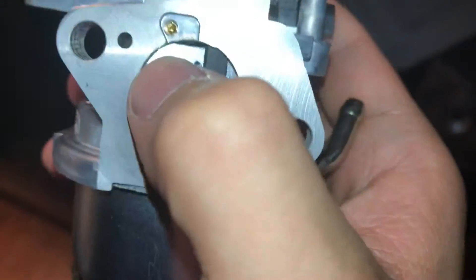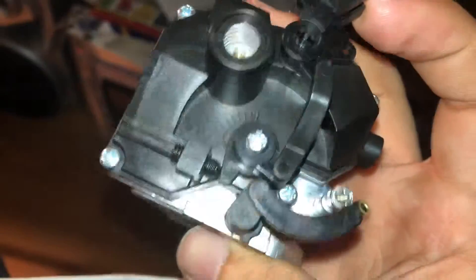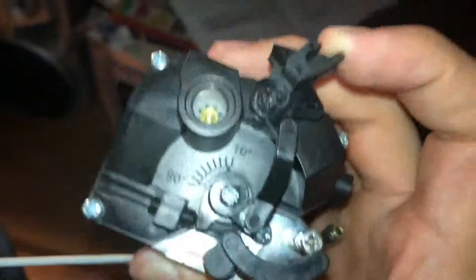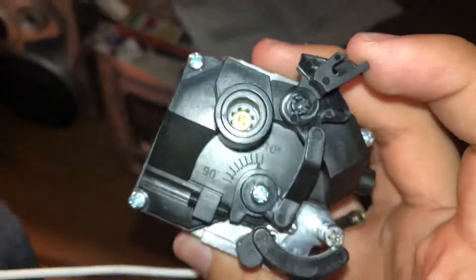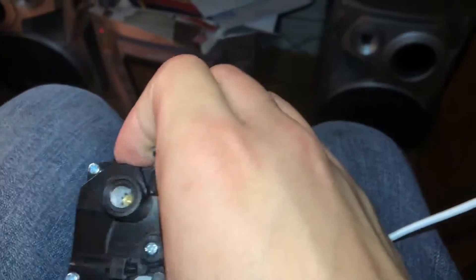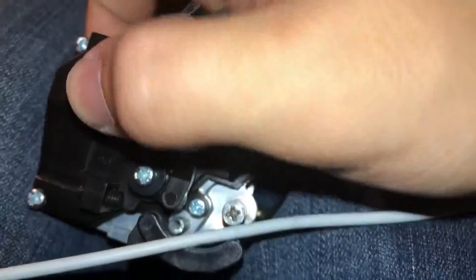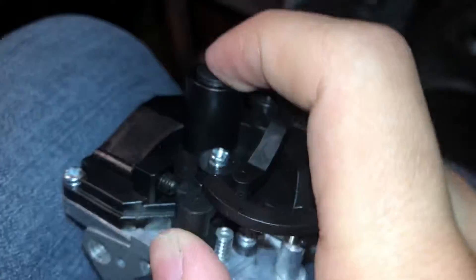I'm excited to play around with the air fuel ratio and get the optimal AFR for that minibike, because it doesn't like the top end that much — and I feel like this thing's gonna change that. It's also really short gearing with too much power on the engine, so I might be changing to a 63-tooth sprocket for a little better top speed and hold under load. That stock carburetor was doing something funky — it sounds like it's running too lean, breaking up at high RPMs, but not rich because it's not pumping flames out.